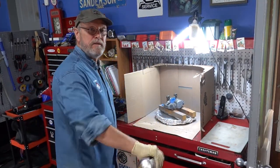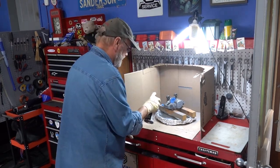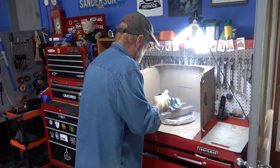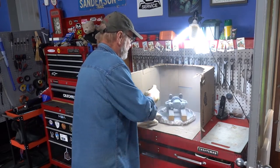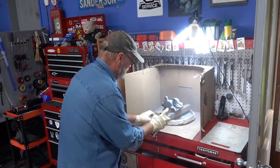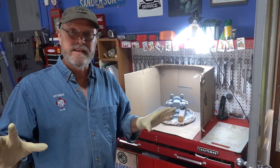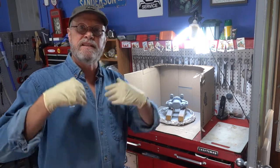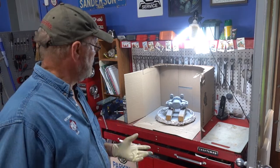Okay, so now I'm going on to my second coat. So again, you see I'm kind of getting the sides of the second coat already. And the thing with this is it has to be done in 1 hour, everything. Otherwise, you gotta wait 7 days to give it another coat because it needs to dry completely, and it starts drying to touch within an hour. So everything has to be done within an hour.